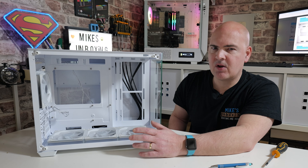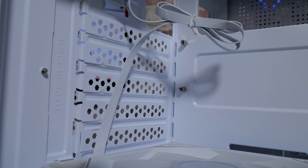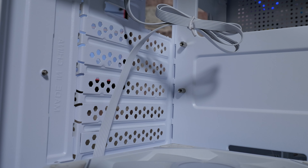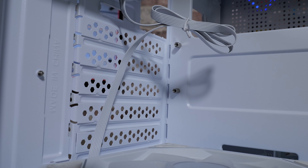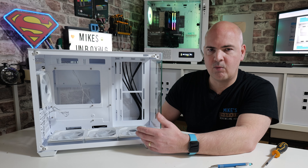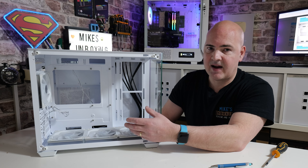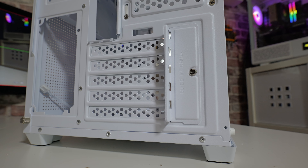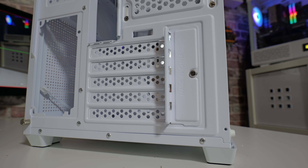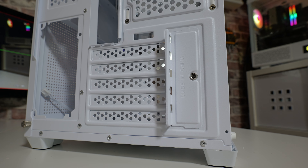Looking further inside, something I'm not entirely keen on is the PCI Express blanking plates on the back — although there are five of them, which is actually a really nice thing to see for a micro ATX case. Generally they tend to have three or four, so having five gives you a little bit more flexibility. The motherboard mounting is also slightly higher, so if you've got one of those motherboards where the PCI Express slot is a little bit lower, even with a really fat card, it's going to fit in nicely. The PCI Express blanking plates are captive ones, so you'll have to fold those out — I'd suggest doing that before you install your motherboard, because once you've taken them out, they won't go back in.